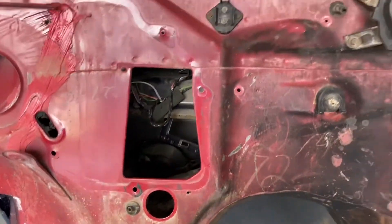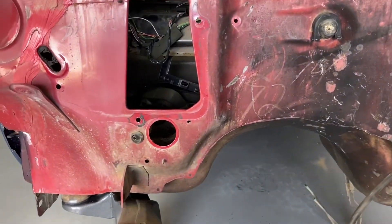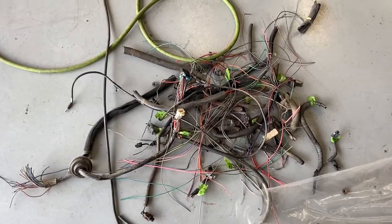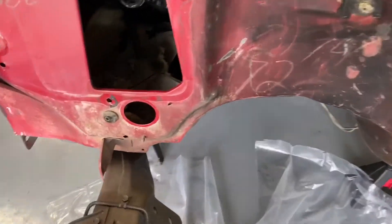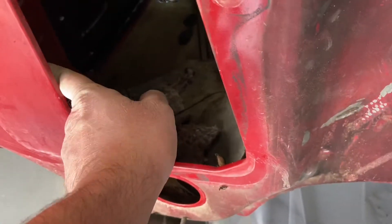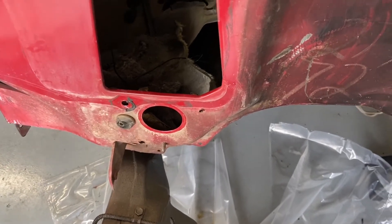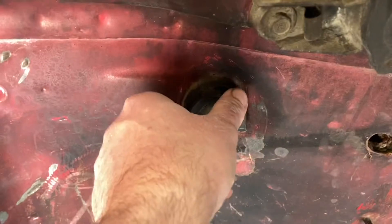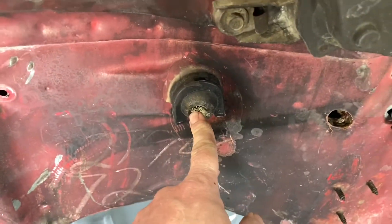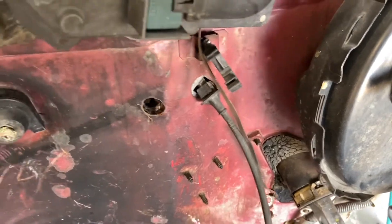Next, I'm trying to paint the firewall today — that's the goal. I had to take off some of the wiring. All the wiring connected to the engine, like through the ECM, typically came from this bundle here. I cut those wires off and pulled them through. I've got to make a block-off pipe for this today. This one I still need to get rid of — it's for the air conditioning. This right here is actually a throttle cable, so I just have to take that off.